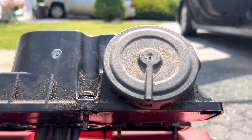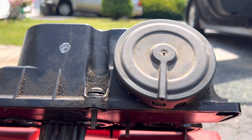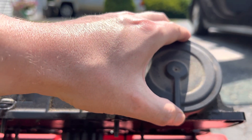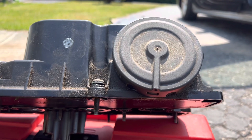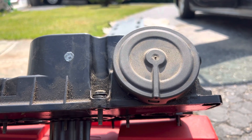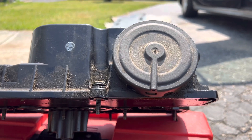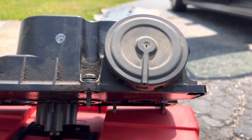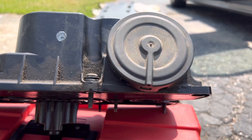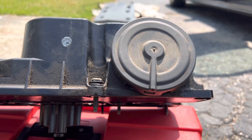This car has about 200,000 miles on it and this diaphragm's still good, I think — unless it's stuck open, which I doubt. What you hear is that these'll start to tear every 40,000–50,000 miles, and this car has 200,000 on it. Similar story with the MAP sensor — I hear those go a lot, but I hooked up my OBD-II and went to live data, channel two on this car, and I was reading pressure changes that seemed to check out. So maybe I got lucky with this car.